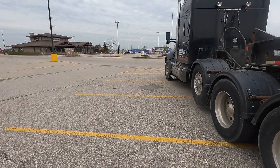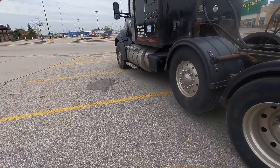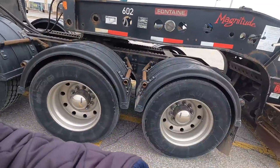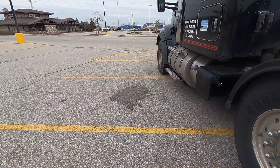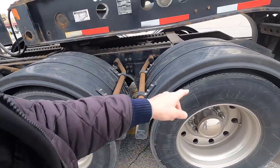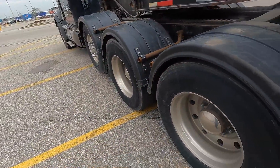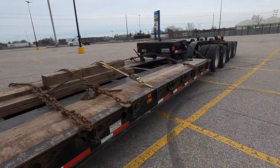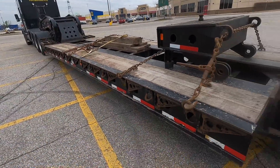This morning I went to Kelty down the road and asked him to set tire pressure. I checked the temperature in Omaha, Nebraska — it's going to be 30 Celsius, almost 90 Fahrenheit next week. I said give me 110 on the steer, 120 on the trailer. He checked and said your super singles are at 120 — do you want to leave them? I said no, make them 115, and make the others 110. He had trouble getting the valve cap off the inside tire and had to use pliers.